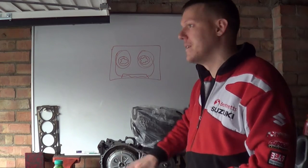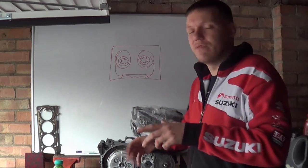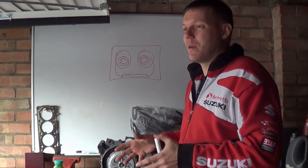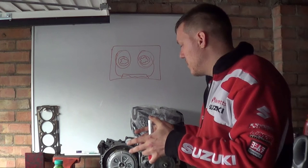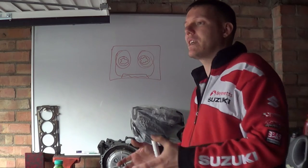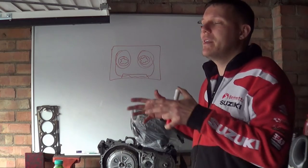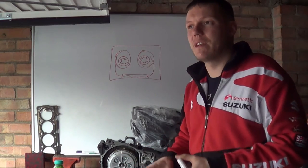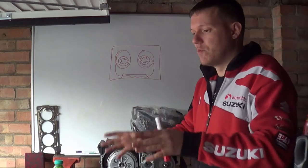It's bolted in on a bearing carrier inside the engine, so you have to design it into the engine arrangement basically from the ground up. If you try to modify a normal bike into a cassette gearbox, someone will just laugh at you — you'd need to start from scratch or buy a different engine. They've turned up in recent years — in the last 10 to 15 years — though as you can see with the CX500, they had a cassette gearbox back then too. Why are they fitted to production bikes? Maybe they built an engine block without the transmission in mind, not knowing exactly what transmission they were going to go with, or if they weren't sure the engine was for one particular bike.